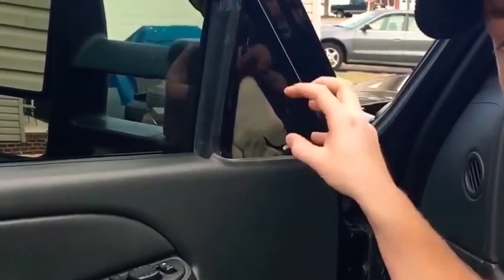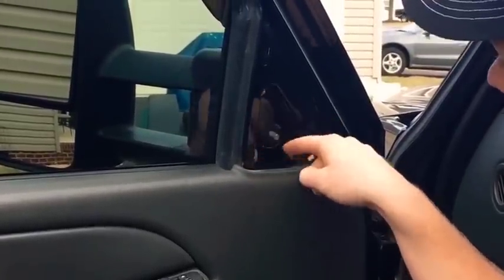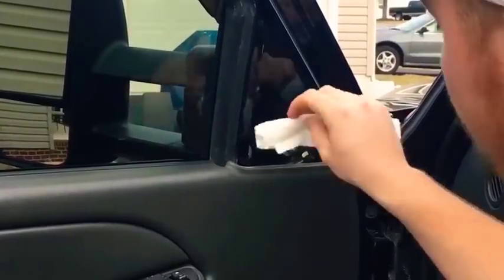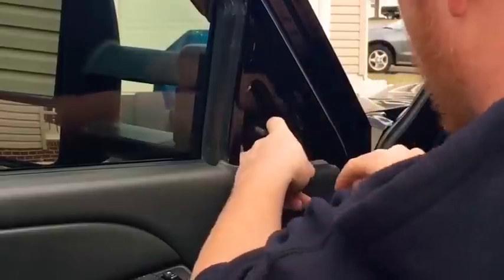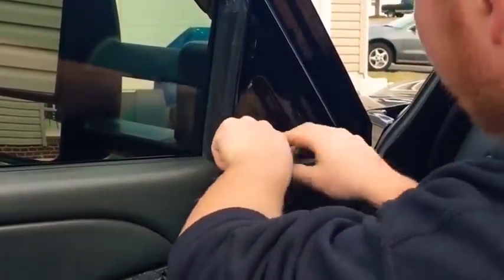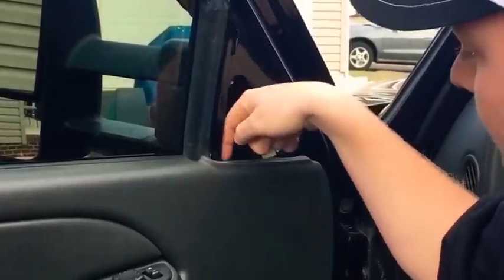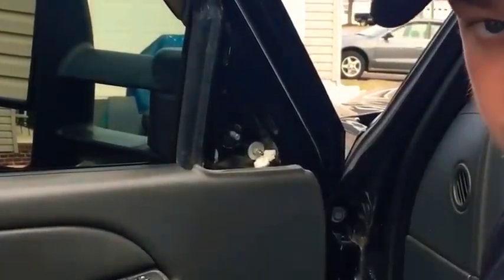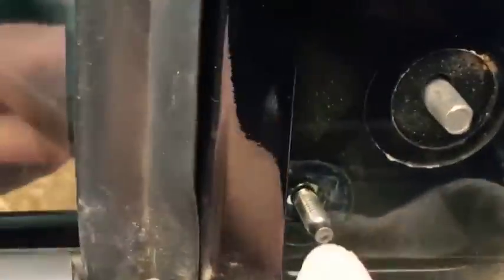To access the back of the mirror where the bolts are, pull out the piece of sound foam. You'll see three 10 millimeter bolts. Use your deep well socket because of the depth of the threads. I highly recommend placing a paper towel or cloth right underneath the bolt area, because if the nuts and washers fall, they drop down into the door frame itself — not the door panel — and are very difficult to retrieve. This takes just a moment and can save a lot of headache.